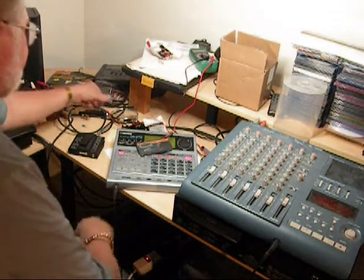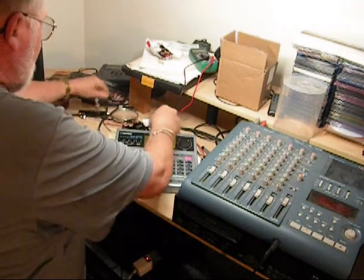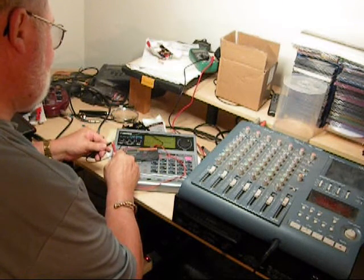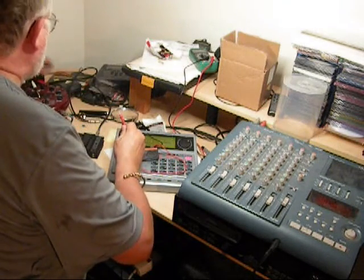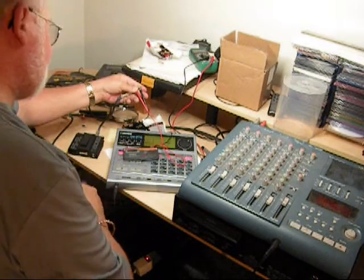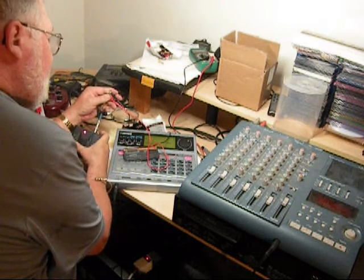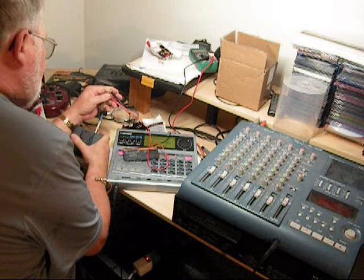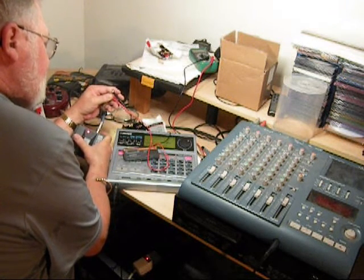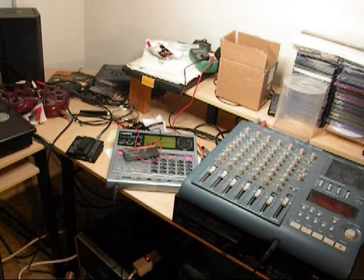Okay, let's check out this foot switch. I'm going to hook it up to my VOM and see what it's doing. Remember, if I touch them together it just goes random — no, it goes zero, and then it's like random. We'll see what it's doing. I'll put the red there and the black there, and it's saying it's just going random, which is right. We turn on this machine here and it says zero volts. Hit it again — that's just going crazy. Hit it again. Zero volts. Well, zero volts isn't going to do it — we need three volts, like the VOM was putting out.